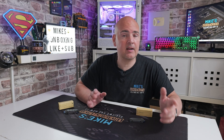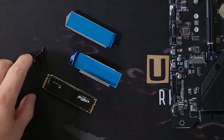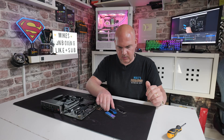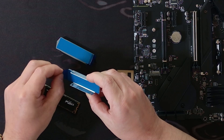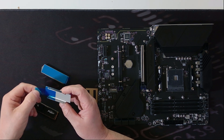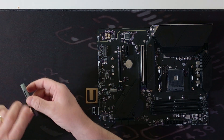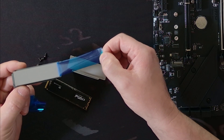I think we've talked enough about the devices themselves — let's take a look and see how easy they are to actually install. We're starting with the M.2 2280, the non-pro version; installation will be basically the same across both. I've already taken the screws out of the side so it's ready to go. We'll start with the base section and just peel off the blue protective coat from the thermal pad. It's quite a thin but very gummy pad, so be careful when peeling off the blue film that it doesn't come off entirely. Due to the heat and humidity in here it seems to have started peeling a little bit, so do be careful with that.